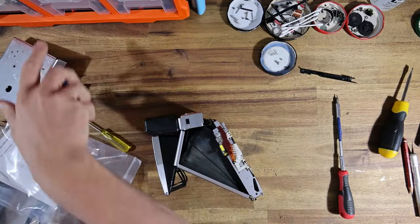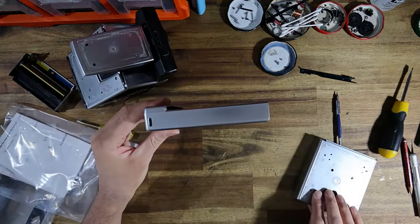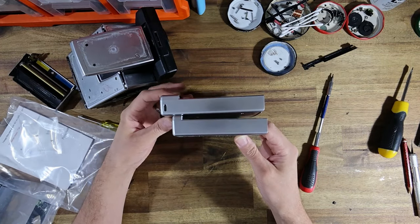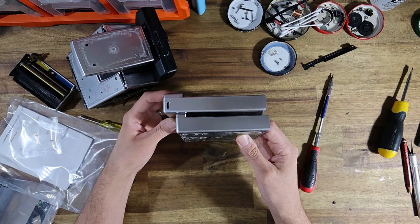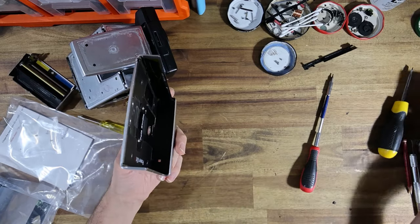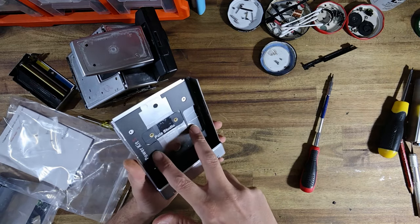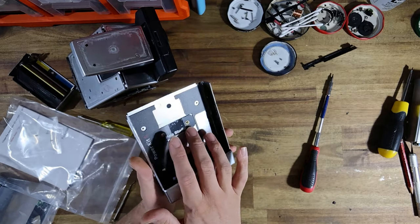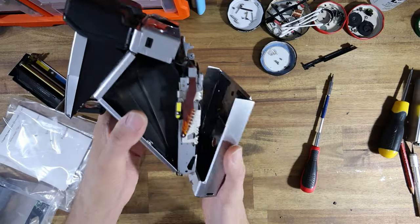inside in the rear housing, so basically what they've done is made an exact reproduction of the original Polaroid bottom panel. They've just lengthened it about 5 millimeters, so the camera is ever so slightly longer, but it is otherwise an identical copy. And sitting in the back sits charging circuitry and a lithium ion battery, and it actually sends through the panels onto these two little brass terminals at the base, and that is what connects to the original terminals and will ultimately power the camera.